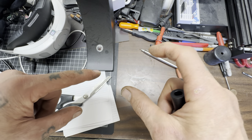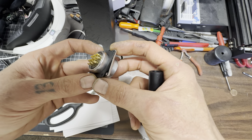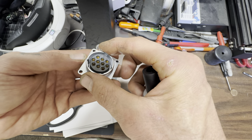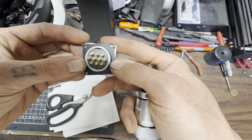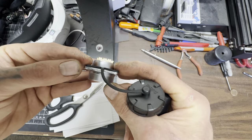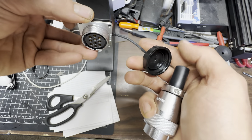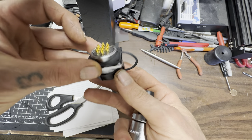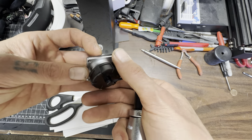I'm going to weld in a piece of steel with a couple of holes in it. I'm going to need a hole that big with a hole saw, and then it seals up to the firewall. It's got a nice plug cover and a firewall grommet so no water will get into the cab.